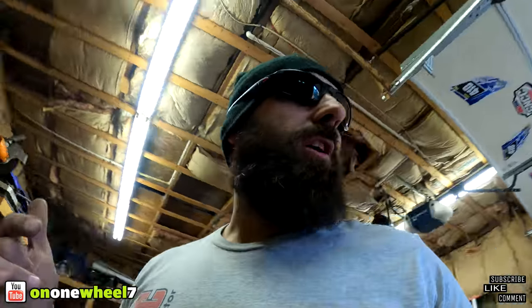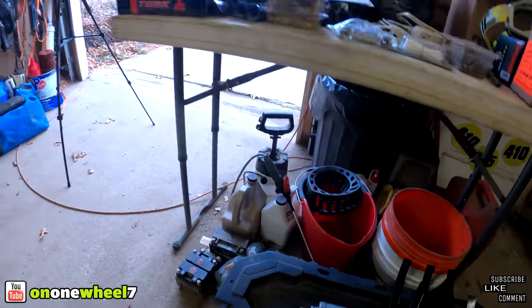It's getting tired. Many of you who race know, we all run 24 volt starters, and it definitely shortens the life of the starters. Eventually, they almost start on 24 volts like they were on 12. I got a starter here. That starter is 7 months old, maybe a little less, not a lot of time on it. That was from the old race bike, the old new race bike. So I'm gonna swap that in. This thing should fire up super fast and be good.